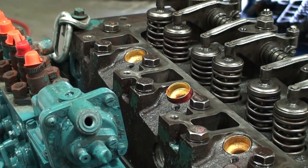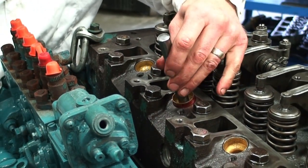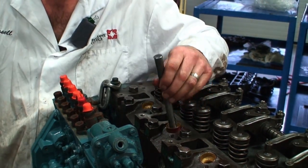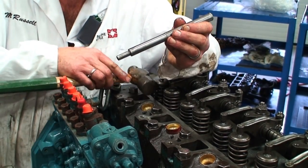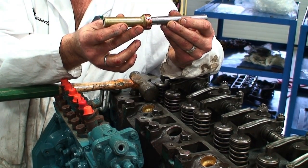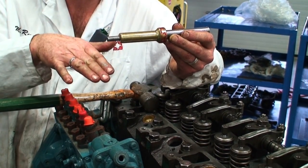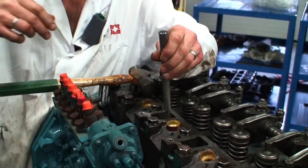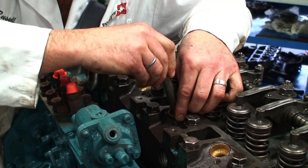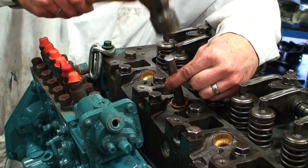Now I'm going to put it into position. We have a driver that goes through the sleeve. The important part is when this is being done, the pistons on that particular cylinder need to be lowered. Because it's direct injection, the driver is actually going through the sleeve — if the piston is in the way, we could potentially drive this anvil into the top of the piston creating damage. So it's important to make sure the piston is down, which it is. We put it back into position and correctly position it into the cylinder, then we're going to tap it down into its correct spot.